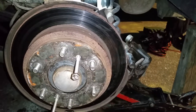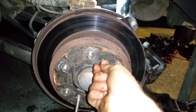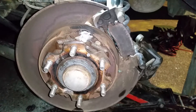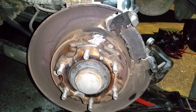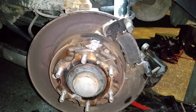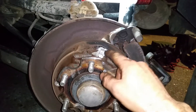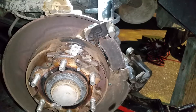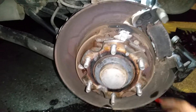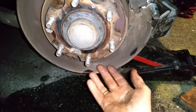You should use some sort of anti-seize, but just be careful to prevent any grease from getting onto the braking area. Once you break it loose, you can pull it out — it comes out very easily. Then you start cleaning these parts because they can contain a lot of asbestos dust from the brake pads. Use brake cleaner — you can get a can for about three dollars — and clean everything well until you don't see any dust. Then lubricate; don't use white grease. I lubricate with a special high-temperature silicone grease that you can find at auto parts stores.